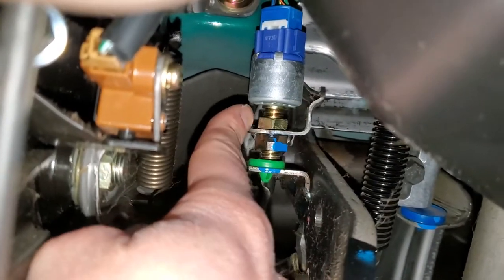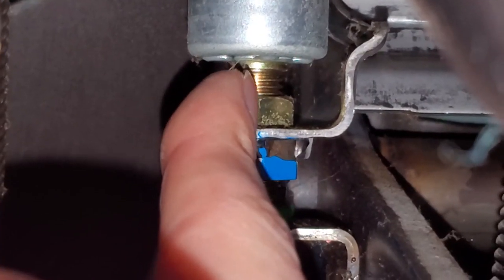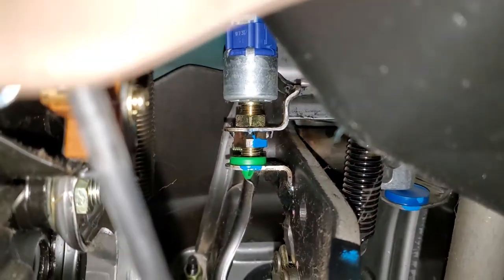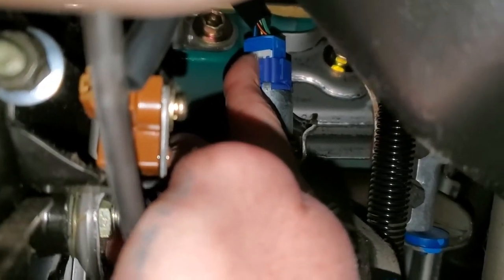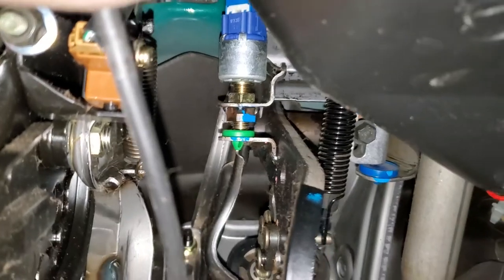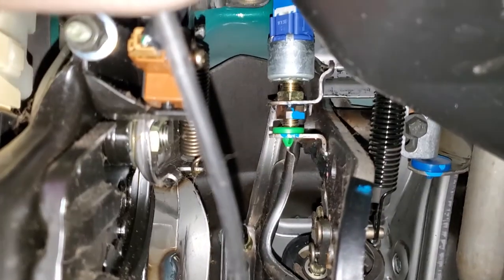To remove this, you're just going to need a 14-millimeter open-ended wrench and you're going to loosen that 14-millimeter nut right there. You just have to loosen it like not even half a turn. Once that nut is loose, the entire switch you can unscrew from the bracket. You'll want to disconnect the top piece when you get a moment in order to prevent twisting all those wires up. When you have your new switch, you thread it into the bracket just adequately enough to where the plunger is pushed in and the brake lights come off, and then you lock it down with that 14-millimeter nut.